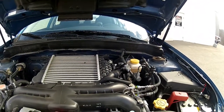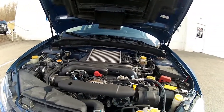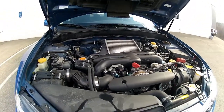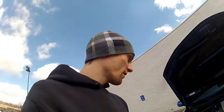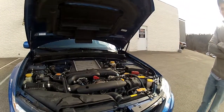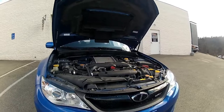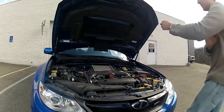I guess if it's mostly recirculating, you know, like 10%. Yeah. If you're mostly recirculating, you're fine. If you put full atmosphere, like shit. That's what's bad. But I had it at like 50-50. Yeah. And it was running a little rich between shifts, but that was it. And then when I closed it up, it runs just like normal and you get the sound. Could you tell it was running rich? It would backfire? In between shifts. Not backfire, but like pop, pop. You didn't get any check engine lights or anything like that?